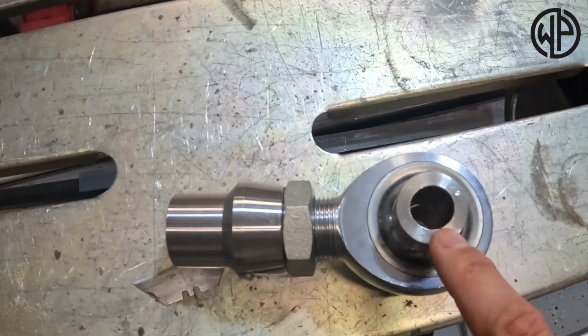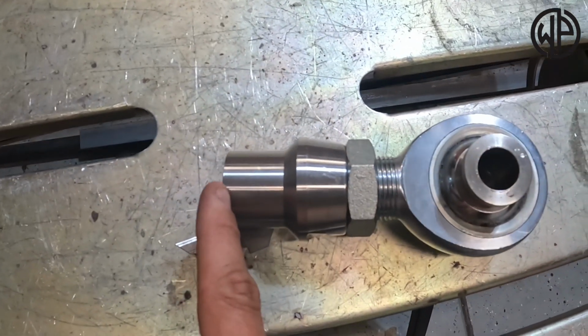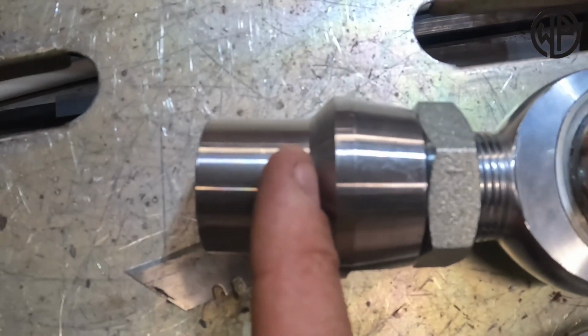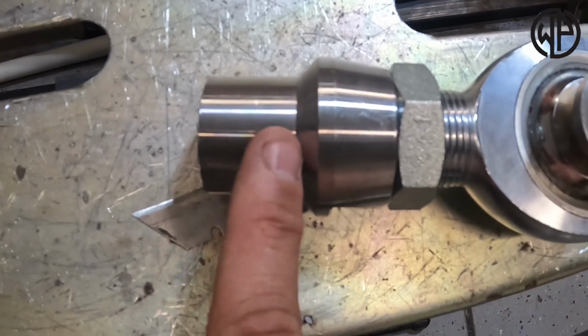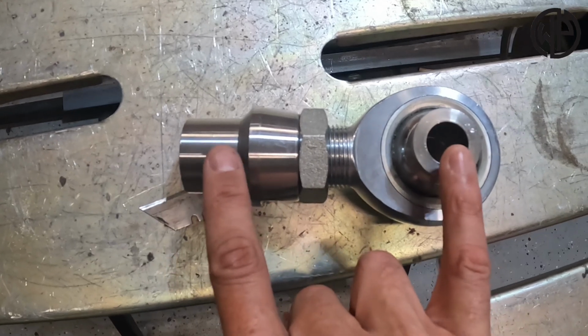I don't want to set it at the minimum because then you can never make it longer, adjusting your pinion angle or potentially fine-tuning your wheelbase. Now the measurement I'm gonna take is gonna be from the center of the bolt hole to the point where your tubing inserts, to this little crease mark right here. And on this, it was actually 3 3/4 inches, which means that 3 3/4 inch times 2 is 7.5 inches.